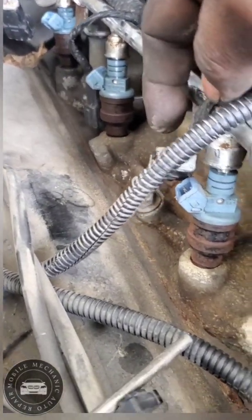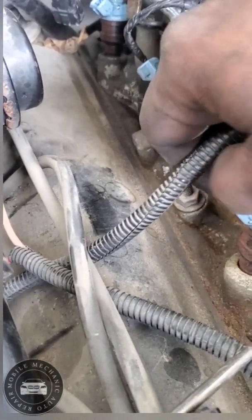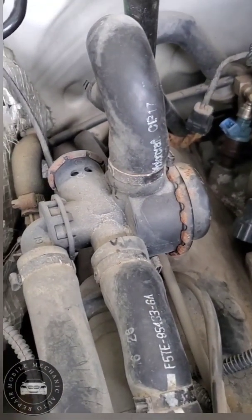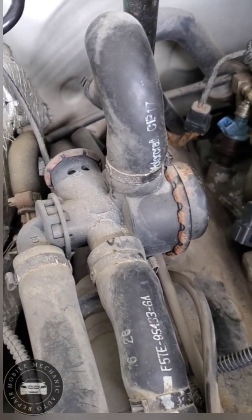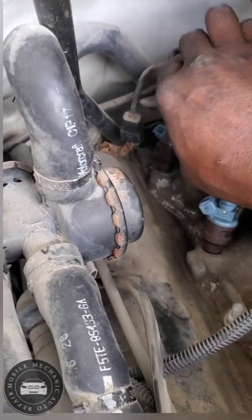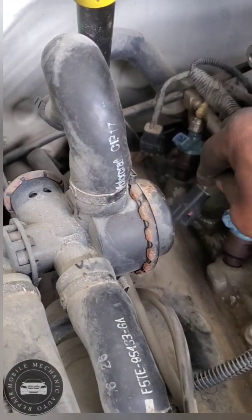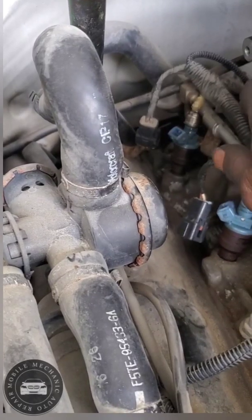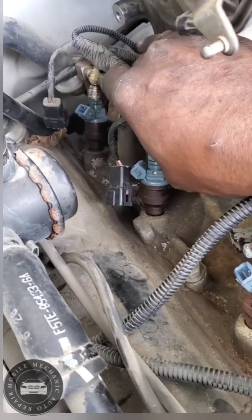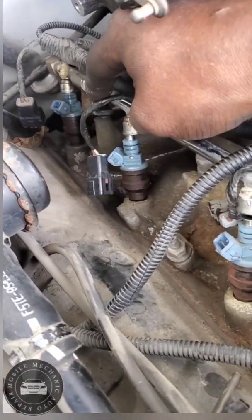Now I have to fish out those O-rings. So you just go one at a time, blowing it out. Pretty much one at a time. Whatever stuff was in the fuel rail is going to basically leak out. No problem, no biggie. We go one at a time. 1, 2, 3, 4. And do the same as on the side.